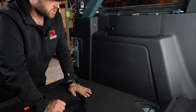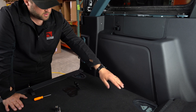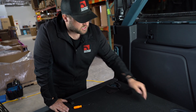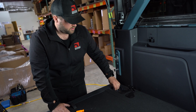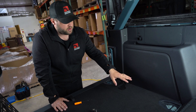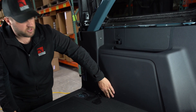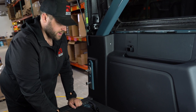Now I've got my four exposed threaded holes. I'm going to start with the front bracket, slip it into place up front, do the same with the rear, and then reinstall the tie-downs. I'm sliding the brackets up along the sides. If you were doing both sides, it may be easier to remove the tie-downs from both sides so the whole subfloor can shift and let you get all brackets into place at once. If you're concerned about scratching the plastics — they do scratch easily — feel free to put blue painter's tape there for this step.